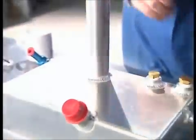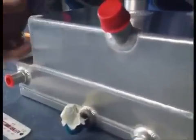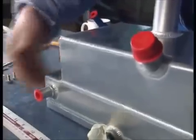If you have a look inside, you'll see that this helicopter actually has two radiators — this is the big one, and then another little radiator that's inside this oil sump. The idea is that the water from the engine's cooling system flows through that little radiator in here, and the oil from the engine surrounds that radiator, so both the oil and the water are kept at the same temperature, which is good news for the engine.